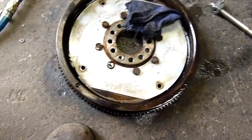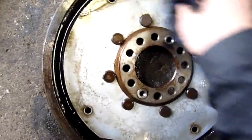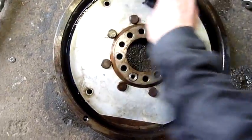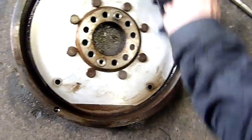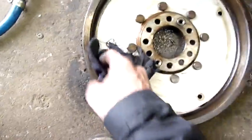So yeah, this drive plate looks completely serviceable. There's a bit of rust and stuff, but that's about it. A bit of moisture's been leaking through. But it's not cracked, so that's good. This goes for a Borg Warner built 3-speed for the Jaguar. Borg Warner built the boxes for Jag.